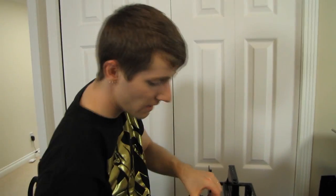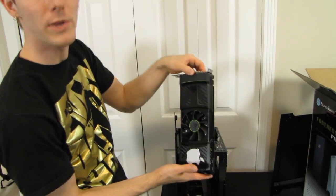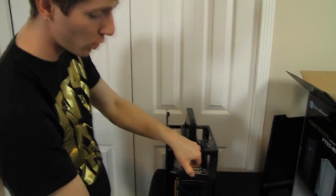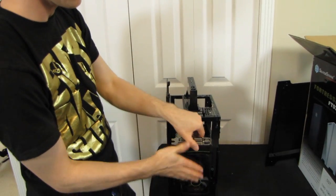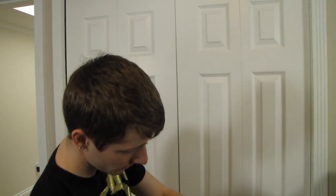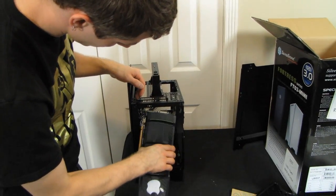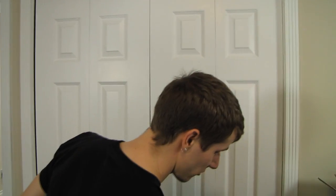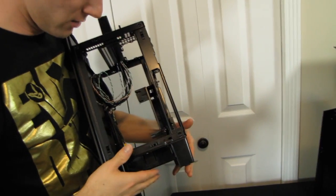However, there are some caveats. If you put in a high-performance graphics card, you want a rear blower card. So one with the fan oriented here and blowing the air out the back, because that will cooperate with the natural airflow in this case. Something like a GTX 590, which blows air out the back as well, is going to fight the airflow of this case. So even though the case can probably fit it, oh, no, it can't anyway. Well, there you go. So even though the case could potentially fit cards that have fans here blowing out the back or here blowing out both sides, you want to make sure that you're optimizing your configuration for the case that you're planning to use. So that means fan here, blowing out the back, and then you won't have any issues.